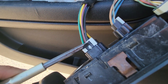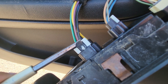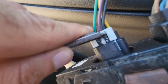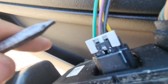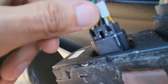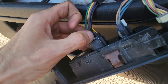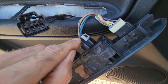This connector has a gray safety clip, so first you have to remove that to be able to unplug it. Work with one hand — just lift it up all the way, then push this pin in and completely remove this part. Once that is done, press onto the black tab and unplug the connector. You will do the same thing on the other one as well.